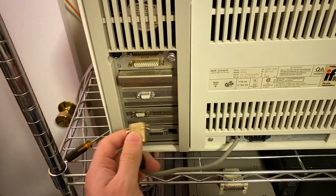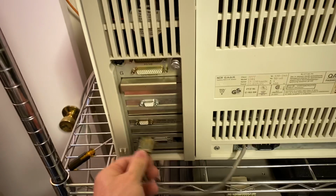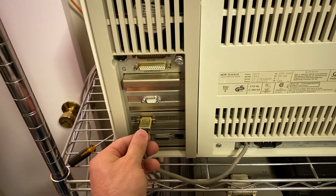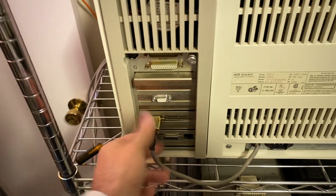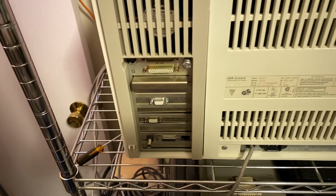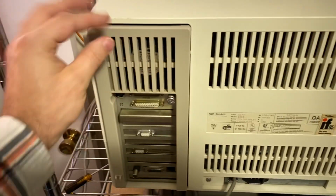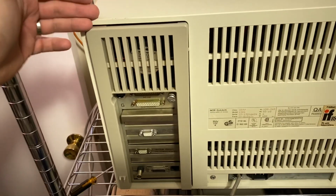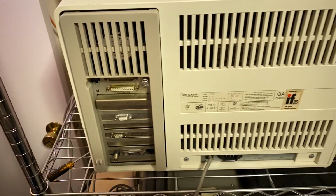There's a D-sub connector at the front of the motherboard that gives it power, but annoyingly video we still have to hook back up, and this connector is designed with kind of like jacking screws. You have to screw it in. If you just put it on there, it doesn't actually make a connection. So that's a little bit annoying, especially when you're trying to troubleshoot the system, because you have to take the computer part out every time to get at it, which means unhooking and rehooking the video. Gets a little tedious, but that's okay.